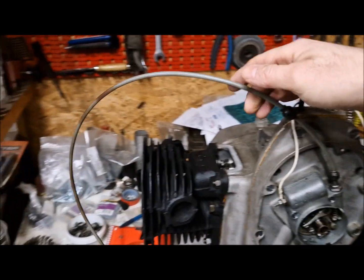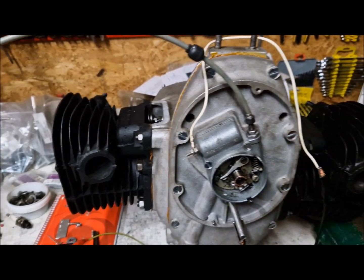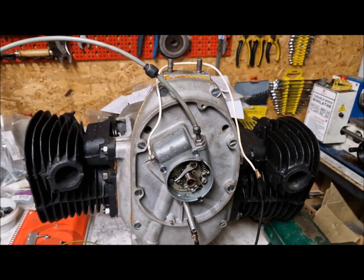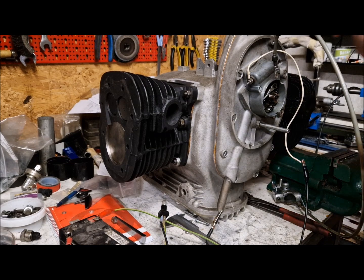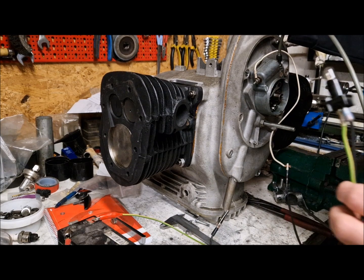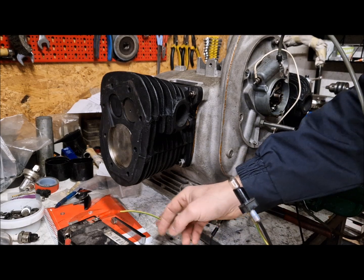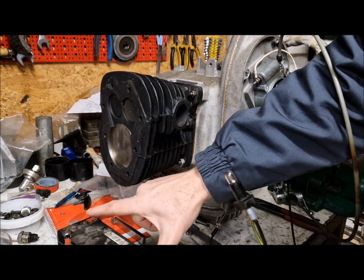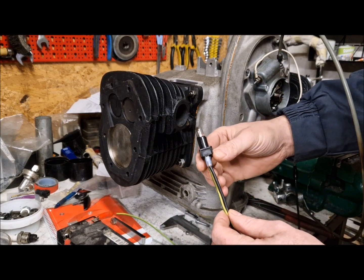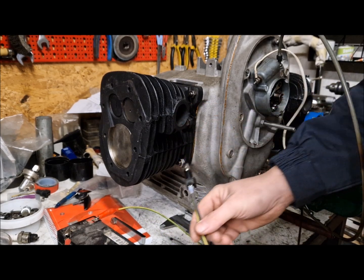As you can see, I have an original cable for the ignition and also the controls in order to make the setup for the ignition timing. In order to make the ignition timing setup, you need a lamp, one wire connected to the points and one wire connected to the plus on the battery. Basically, the lamp acts as the ignition coil.